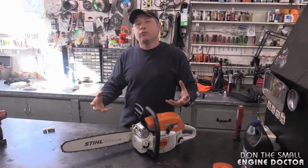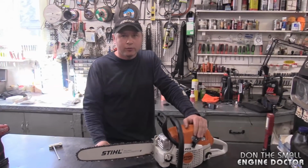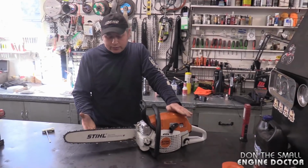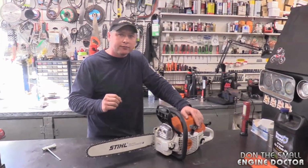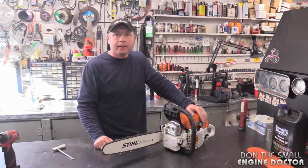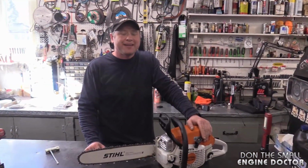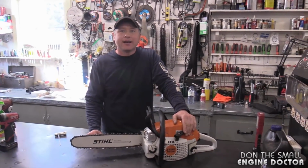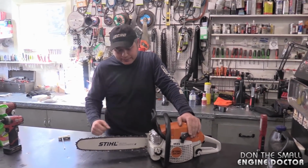However, if the saw warms up and the chain's loose, like I'm still cutting wood all day and the chain's super loose because it's hot, you can adjust it hot, but if you do it hot, be super careful that you don't go too far. So there's a bit of an acclimation process, kind of like if you own a fish, you drop it in the tank to get used to the temperature. It's kind of like climbing a mountain and getting the oxygen going.